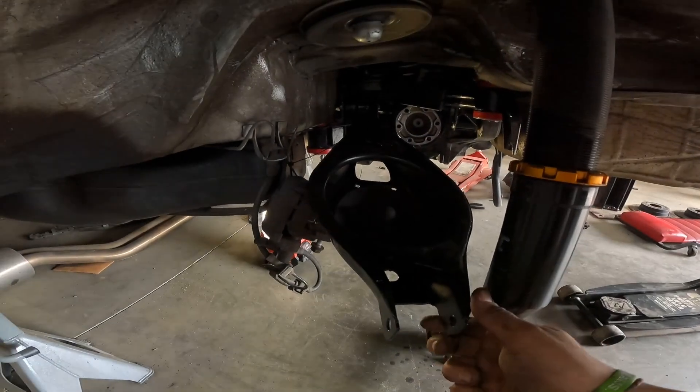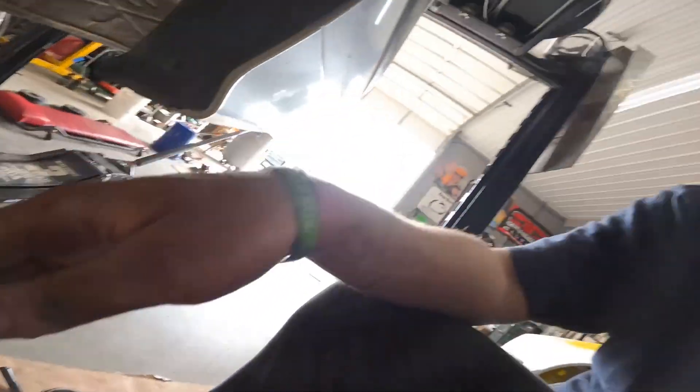That was a nightmare. Apparently you can't put the rear end in before you do the control arm, because the bolt won't back out — it touches the rear. So don't do that. I just had to take it all back out and start over. Now I'm going to put in the shock first, hold the knuckle and trailing arm up with it, and then start bolting it together. I'll let you know the right order so you don't make the same mistake I did.